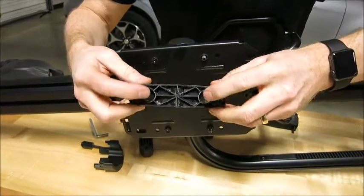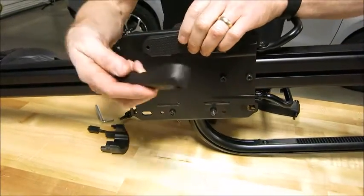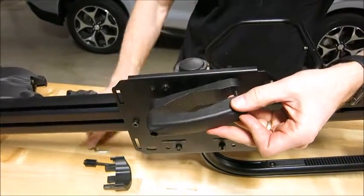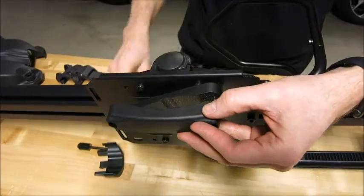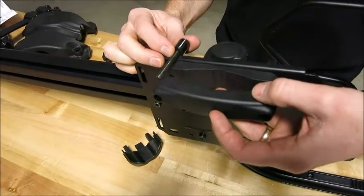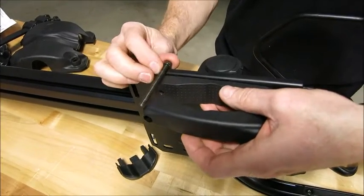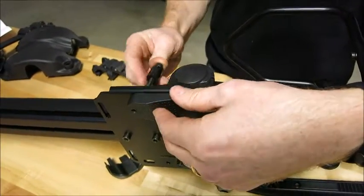On the underside here there are two circular holes which correspond with where those nuts are, so I'll put the underbar bracket in place and run the bolt through there. A pretty clever idea from Rocky Mounts: one bolt length can actually accommodate two different thicknesses of load bars. As it is here, this bolt length is for thin load bars, but I can remove this spacer entirely so the bolt is much longer. Sometimes the simplest ideas are the best. In this case I'm going to keep the spacer in there.